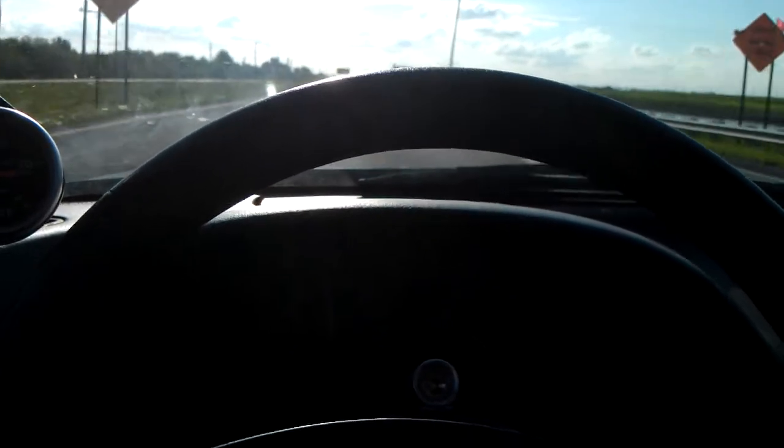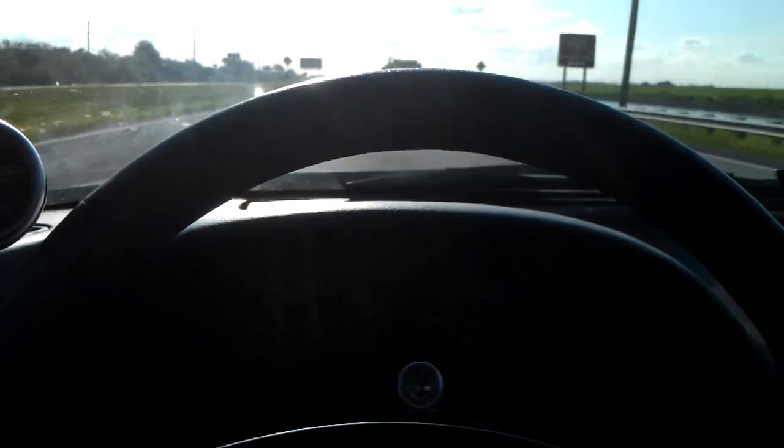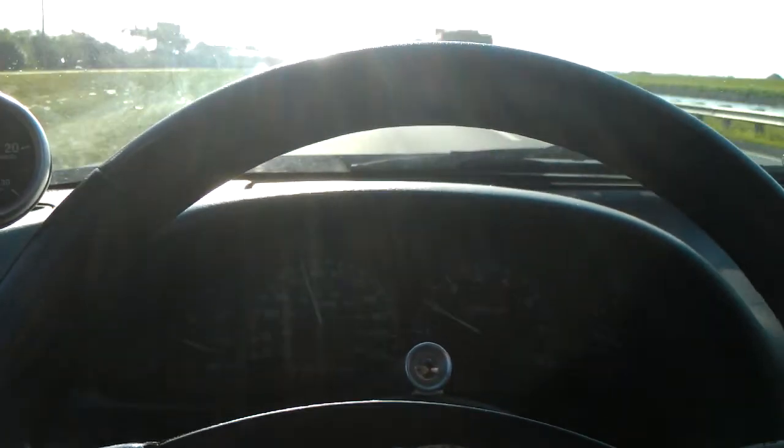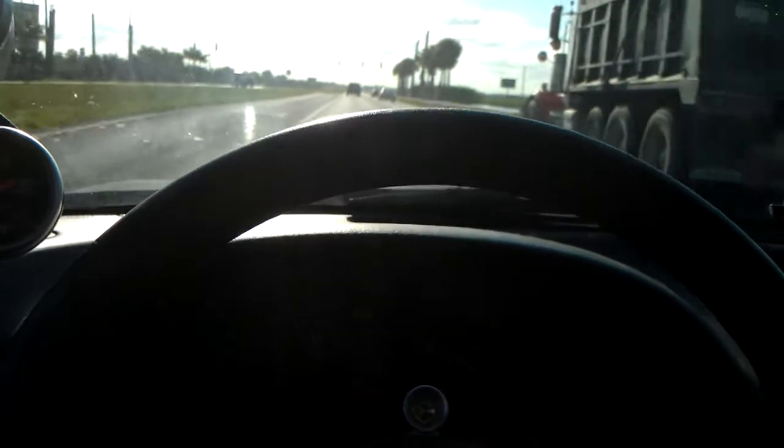Atmospheric timing is generally around 26 degrees. I backed it off just a little bit because people were saying you retard timing and dump fuel to help spool. I'm trying my own little thing and I'm getting better results.